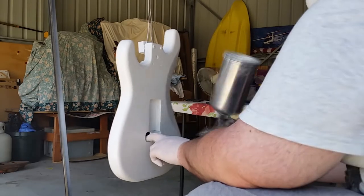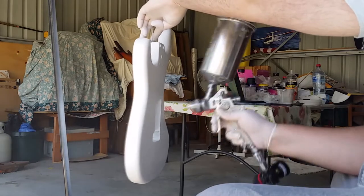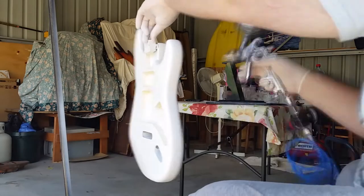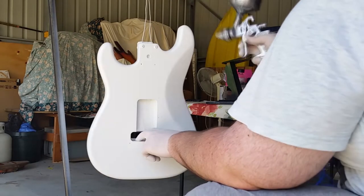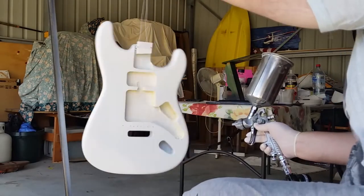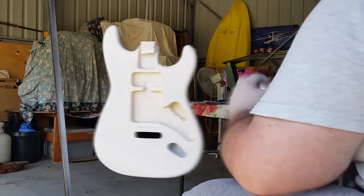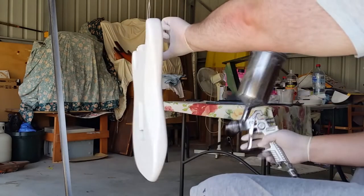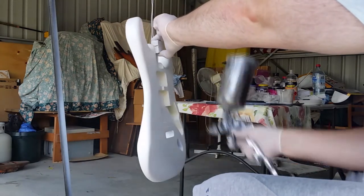I expected that as long as I could get the viscosity down enough to shoot this paint through my gun, I had a good chance of success. When I saw that a lot of the paint matter was clumping at the bottom of the container, even after stirring in thinners for 20 minutes, I was a little bit worried. I just strained it, and whatever paint particles went through the strainer went through the gun. From the video I have, it appears that I laid two passes all over, but there could be a chance that I forgot to turn the camera on for one of the sessions, being that I was so nervous about using this gun for only the second time.